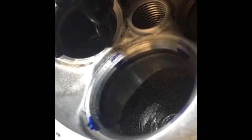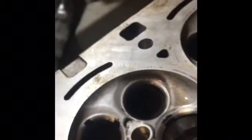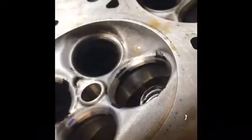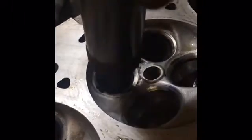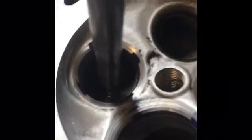You just wipe the coolant, the lubricant off of the surface. We'll put another black mark on it. And then if we put our shaft back into the slot, like so, what we can then do is take our 30 degrees that we just cut with, no spring installed. We can put it down on top, and if we rotate it just a few times, not much. Let's see, maybe a little bit more. We can actually see where, see the black on top, so that's what didn't get cut, but the bottom black ridge is what did.